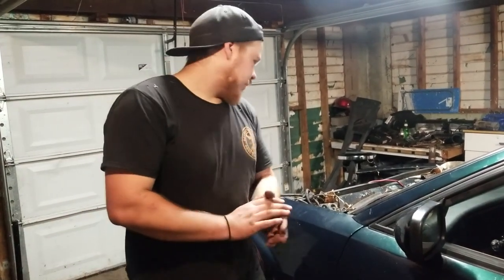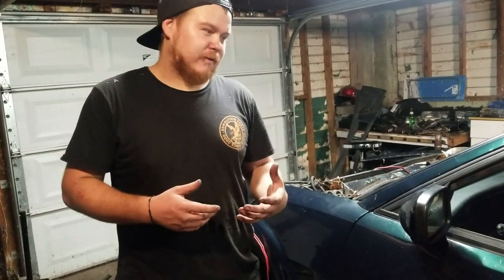All right, guys, that's going to wrap up this part of the video. In the next part of the video, we will have the old harness out, and I will probably record what I do to modify the Mk3 harness to fit. That way, if you guys can't find a Passat harness, and it's a lot easier to find a Jetta harness, you can see what I did to modify it to make it work. And then once I have the harness out, it'll be easier to show you what plugs actually need to be unplugged from the back of the fuse box.